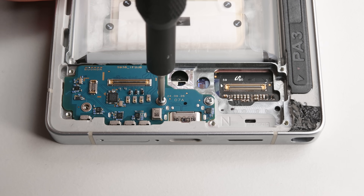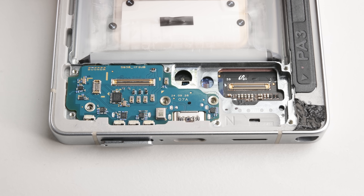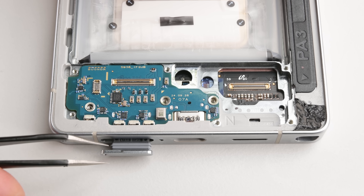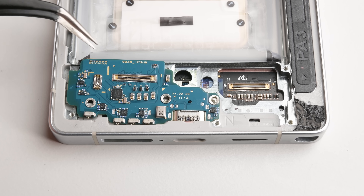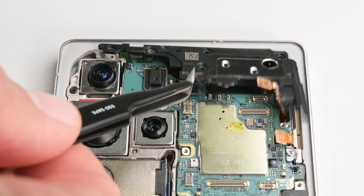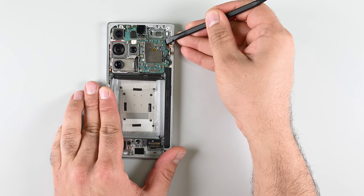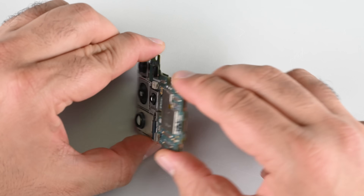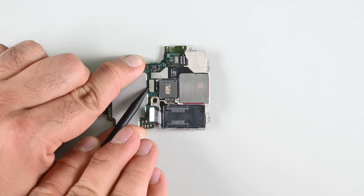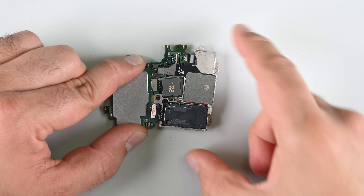Next I need to remove the USB port and charging port module, and to do that I need to eject the SIM card tray. While the S25 Ultra supports eSIM, a physical SIM tray means the phone can be used anywhere in the world — most of the world doesn't have the infrastructure yet to support eSIM. The upper speaker module is next, along with two more screws on the camera bracket. I've only needed a Phillips bit for disassembly so far. The main board and camera module are both released, and the camera module is made up of multiple independent modules, which is excellent for repairability — any damage to one camera can be isolated and repaired independently.